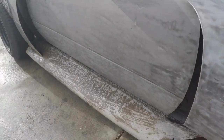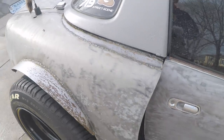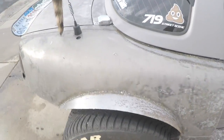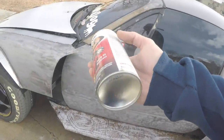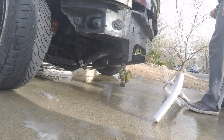I just don't like the orange rust, so I'll do the rest of the car and it'll be good to go. May spray it with a little clear down here to keep it from doing that again. Alright, so I got all the orange off. I'm going to spray it down real good, rinse off all the rest of the acid so it doesn't corrode the metal further, and then throw some of this clear on it just for the winter so I don't have to keep doing this every time it snows. I'll probably strip it off in the summer and let it patina some more. Clear coat this shit.